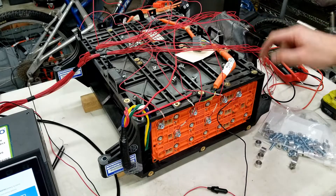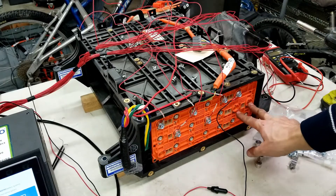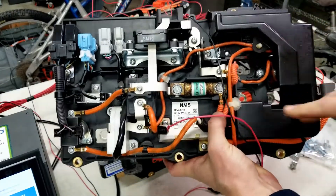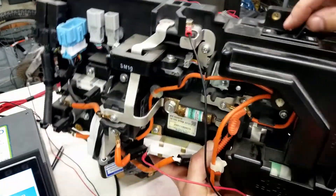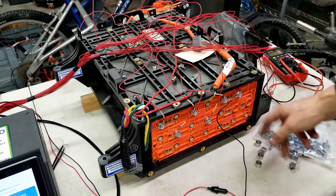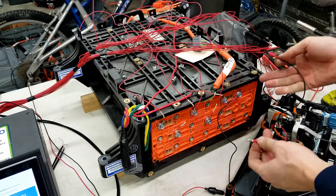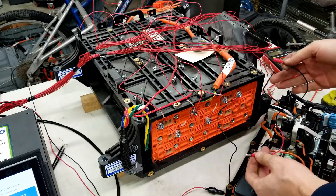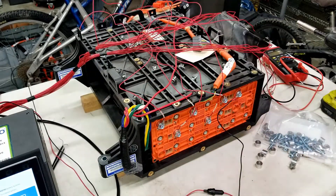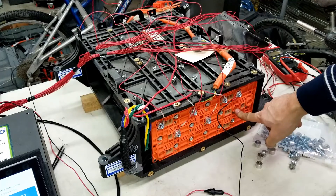I've got the first half of the battery done — modules 10, 11 on the back, and 13 on the back. Now there's a break here in the battery. On this particular battery pack, these two connector points run through a large fuse and up to the battery on/off switch. This is the safety that splits the battery in half electrically. What I'd recommend is to get a couple of wires with bullet connectors so you can have the open circuit and the safety maintained. When it is time to start charging the battery, you connect them — effectively turning this switch from off to on. You may also need to make some voltage monitoring connections to these points, so I need to connect number 12 right here.